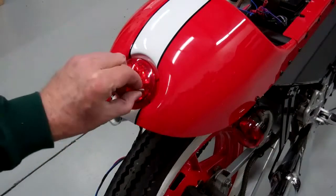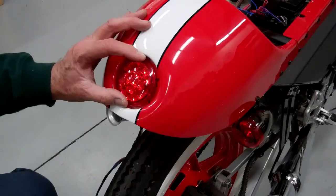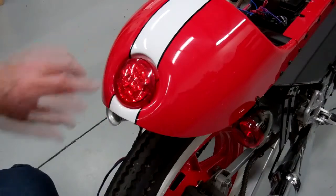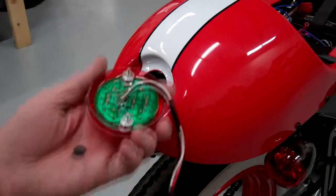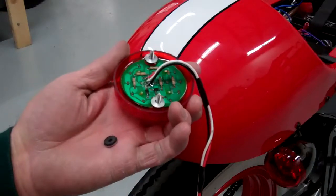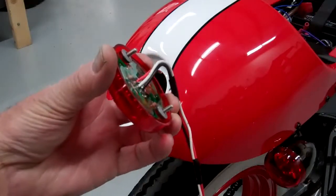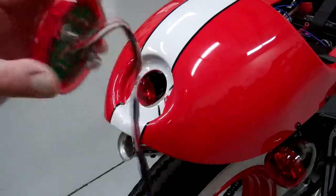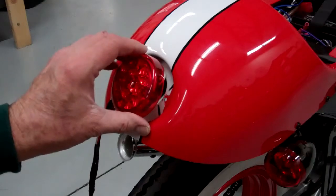Okay, I put the screw in the hole. Go ahead and put the screw in there and that will hold that side stationary. Then go ahead and hold that centered again and do the same thing on the other side — that way when you're finished these two will line up. If you're going to use the side mount license plate, this light is ready to mount. In your kit you've got these little sealing washers — steel on one side, rubber on the other. Go ahead and push those over the screws so the rubber side is against the light. That way when we mount the light it won't sit on the flange — if you over tighten it, it could crack. So that will space it away. Also when you mount this, make sure the wire is going up. Go ahead and mount that light using the nylock nuts we give you in the kit.